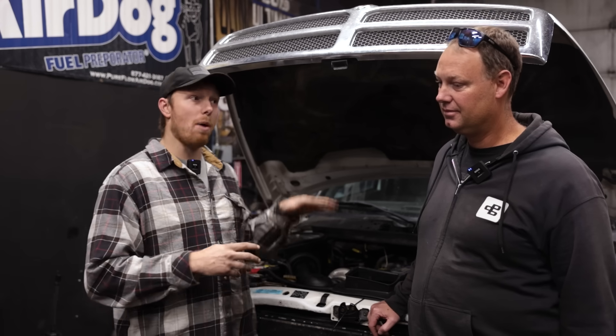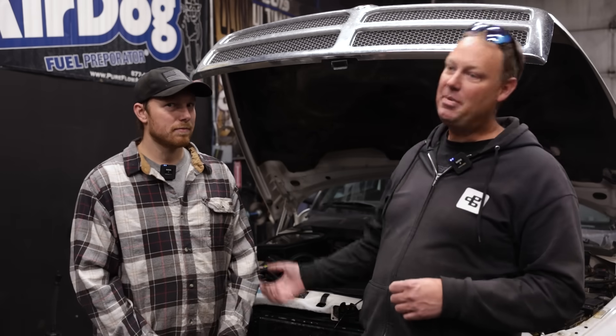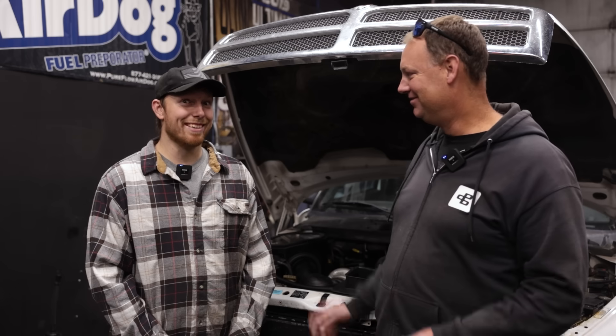Without the lid, that was worse. No box at all, that was worse. The very worst combo we tried: no filter, no tube, no nothing — just open turbo. That made the least amount of power, which is actually really cool. Because on a flow bench you can see it doesn't flow very good. Using a filter to duct the air, almost like a velocity stack guiding it — if you have just an open pipe, it flows worse than a pipe with a filter on it. Very crazy, but it's true. We've proven it time and time again, and the truck backs it up. Now it's time to put that MBRP 4-inch exhaust system on. We'll put the stock box back on to test that alone, then exhaust, then put back on the SMB and Power Driven filter combo. Can we hit 500 horsepower? Let's go.